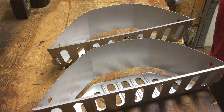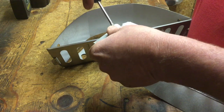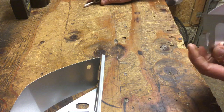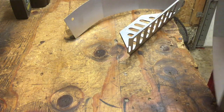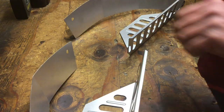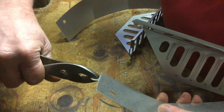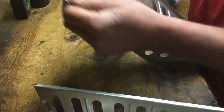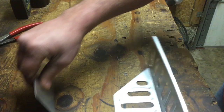First thing we're going to do is open up this back side just a little bit — put your screwdriver in there and twist. We're going to do the right side on that basket and the left side on this one. There are two tabs — just pop them out, it takes minimal effort. Take your plier and we're just going to straighten this tab out a little bit because it's not going back in the slot.